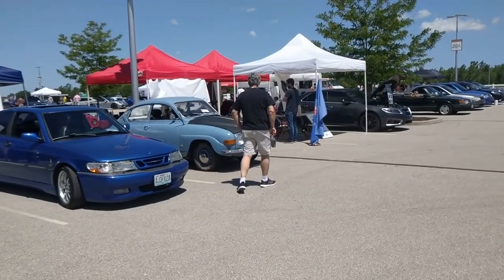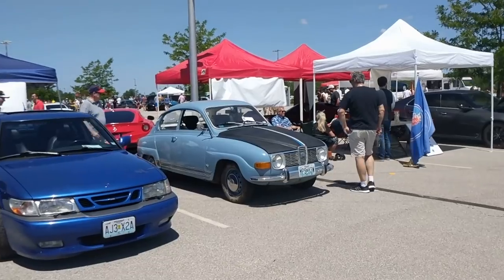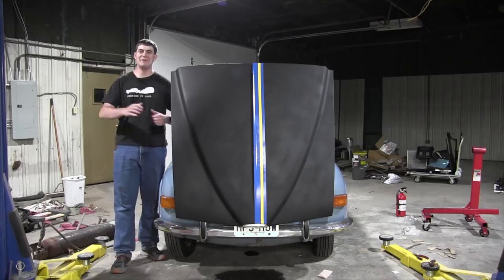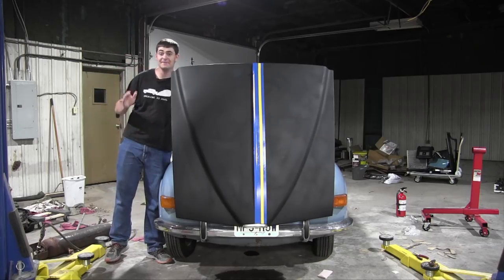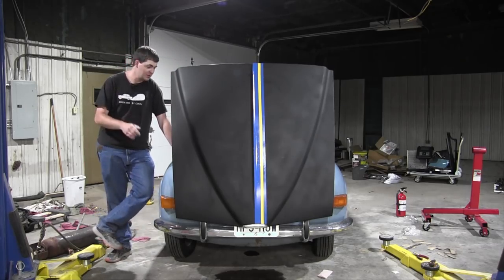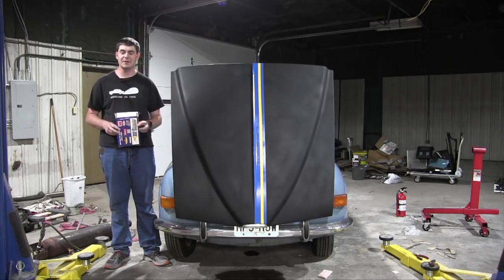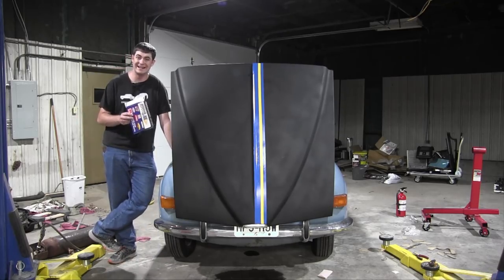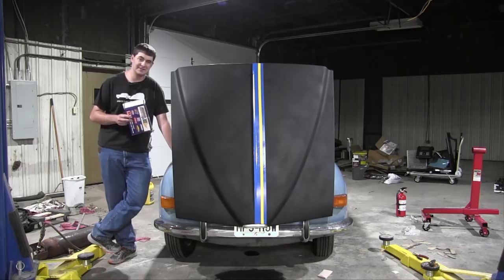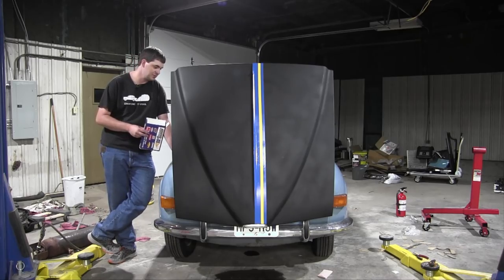With the test drive complete, but not entirely successful, I then trailered the car to the St. Louis European Auto Show. All right, I'm back from the car show now where I won nothing. This is from last year. And I have two tasks to do now. One, I have my carburetor rebuild kit so I can obviously rebuild my carburetor. Now, I'm not sure this will fix all my issues, but it will almost certainly fix my idling issue. The other issue is that it feels like it's running a little bit too lean, which may possibly mean I need new jetting to enrichen the fuel a little bit.